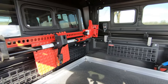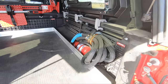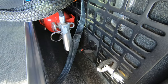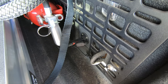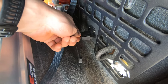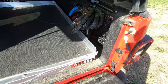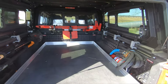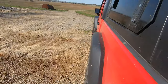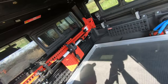I also have a high lift jack base and a tube lifting add-on bracket. On the right-hand side, I currently have my 5-pound extinguisher, but I will be relocating all of my straps here as well for easier access. I also plan to add a 5-pound propane tank mount for easy access cooking near the tailgate. In the stock bed outlet location — which my Jeep didn't come with — I repurposed this area as my solar input. I drilled out the panel and installed a flush mount SAE port, which is wired to my solar charge controller, which is then wired onto the dual battery system.